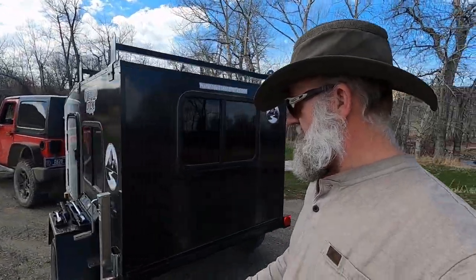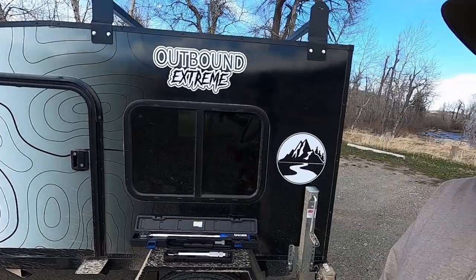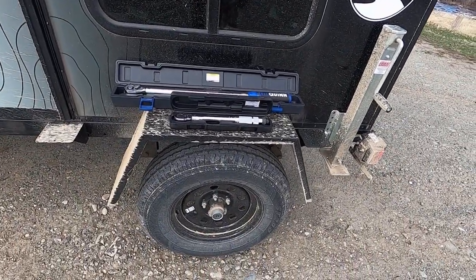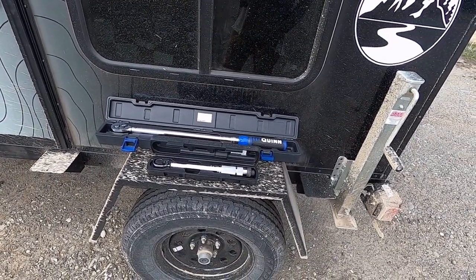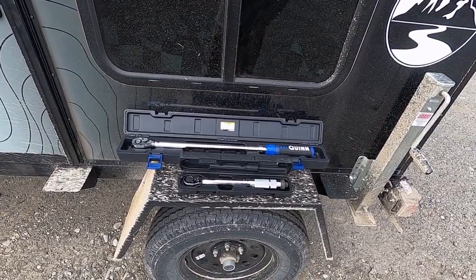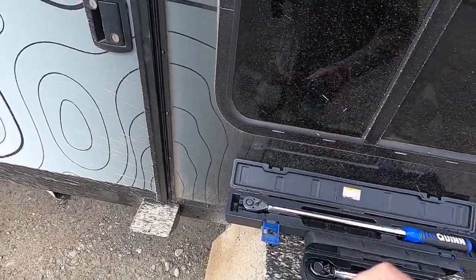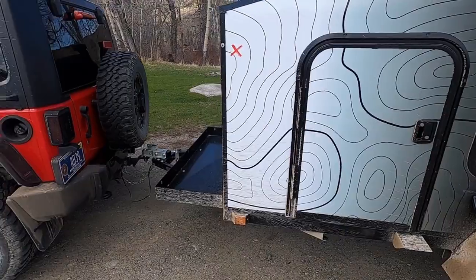It's not a Harley, but still good to check. I've got a couple of tools: a foot-pound torque wrench and an inch-pound torque wrench. The 3/8 bolts run right at 23 foot-pounds, or about 270 inch-pounds give or take a little bit. For the bigger stuff like lug nuts, I have a half-inch drive foot-pound wrench that goes from 50 to 250 foot-pounds, and that pretty much takes care of everything.